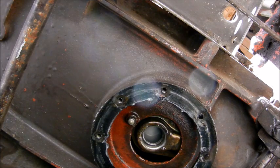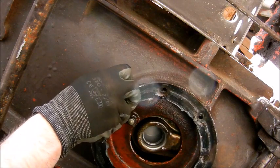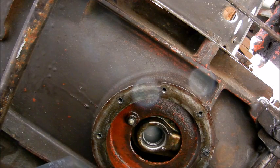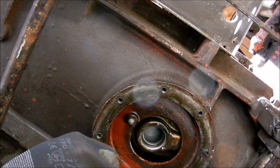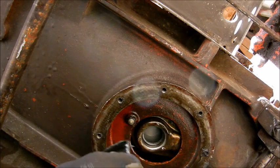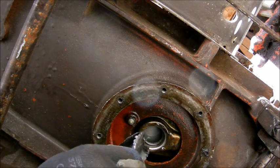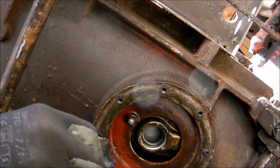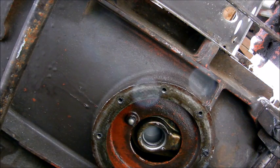I'm going to get some paper towels so I can pick up the camera. I might as well take this guy off while I'm at it — that gasket's totally done. I might need to get a new gasket for that; I was planning on just doing RTV but we'll see. They did RTV plus the gasket. I'm gonna let that drip and drain a little bit and I'll come back once I can pick up the camera.